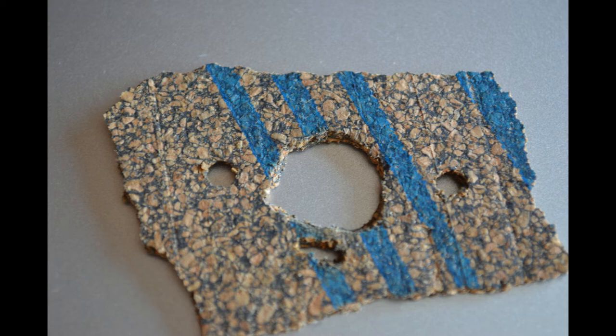Now the fourth hole, the one at the bottom, which is for the air. One of these days maybe I'll post a video on exactly why that's there and how it functions, but you need that port in order for this trimmer to work, or at least this setup that I used, because that's the one where pressurized air goes into the fuel tank, which pushes the gasoline up into the engine and the carburetor, or else you'll get a vacuum and it won't run.